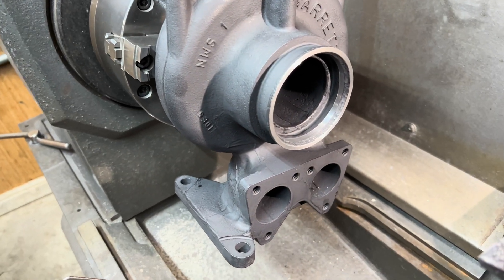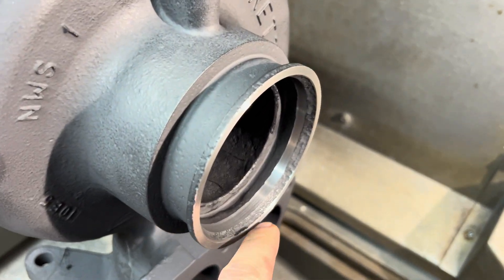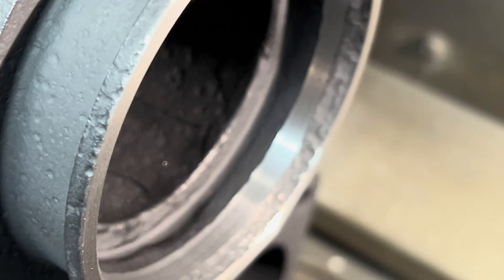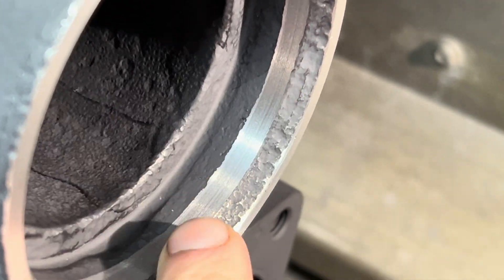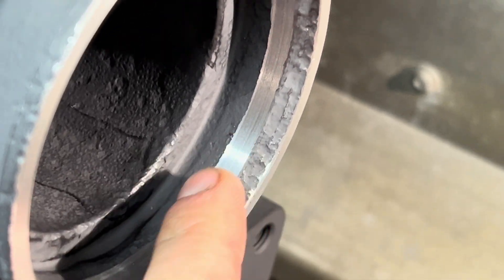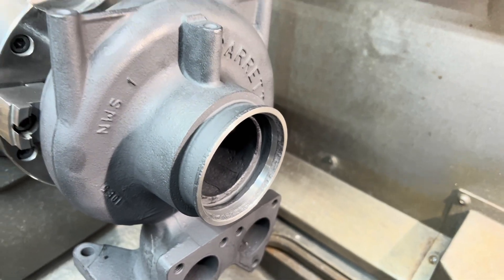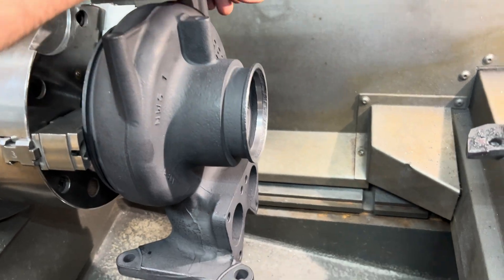The purpose of me grabbing it here and machining the opposite side is for accuracy on a three-jaw chuck. Here's what it looks like after I surfaced it — I just faced that area and then went down and dug in a little bit. That way I can grab it right there. If I start digging too deep in there, it's going to be too thin and weaken this, and then you risk it falling off the machine. With a housing over 20 pounds, that can be really dangerous.